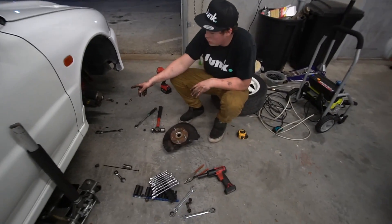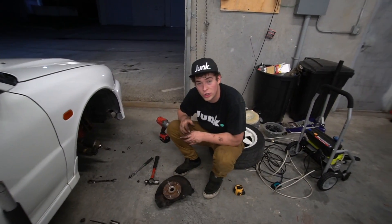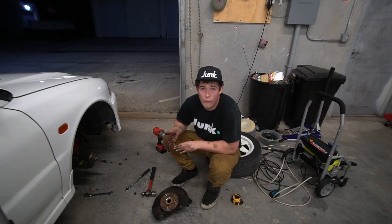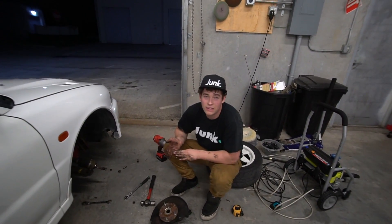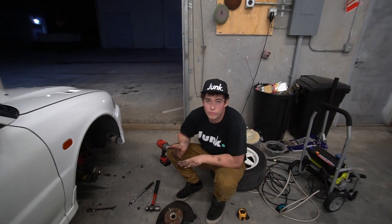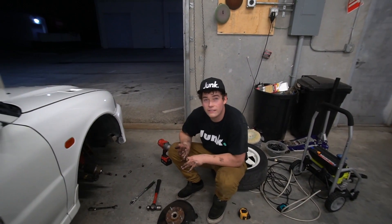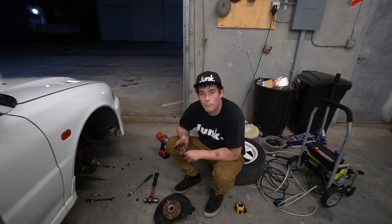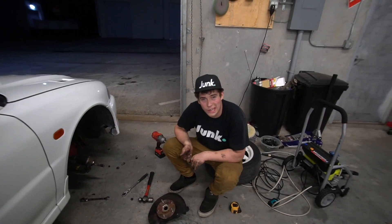I ripped my lower ball joint because my last hammer swing hit the rubber boot and it just started oozing out. I'm kind of bummed — throw it out in the comments what I can do. Because this knuckle will 100% work — guaranteed the knuckle will work. But the axle was literally a hair too small. Back to the drawing board.